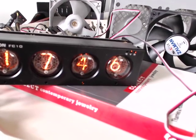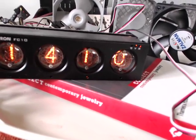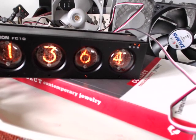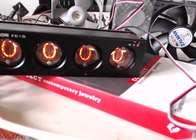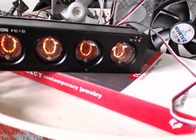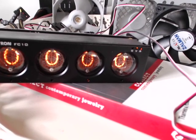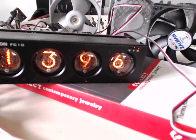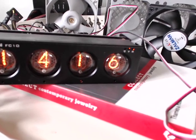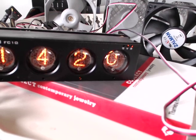These are the revs at 5 volts. If I go any lower now, they'll start to stall, so you wouldn't really want to go any lower. So 4 volts, and you can see they're stalling out there. The reading is not coming through very well. So there you go, 5 volts, and you can't hear them. I'll take these down to 0 now.